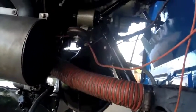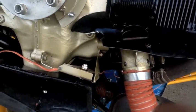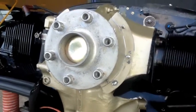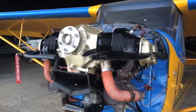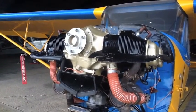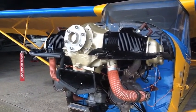The ancillary pulleys are at the rear just here, not easy to see, and on the front of the engine mounted on the crankcase here. There are also two brackets attached to the front of the crankcase here and here. This engine is the C85 with the flanged crankshaft. Fitting the McDowell starter to an engine with a tapered nose crankshaft is a little different, but many of the points are similar.